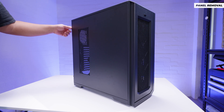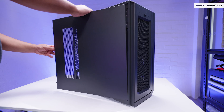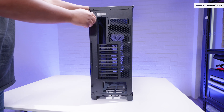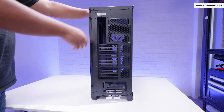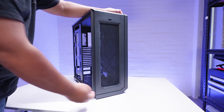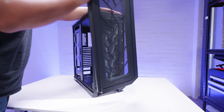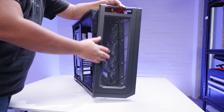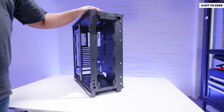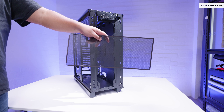Let's start off with panel removal. Each side panel has two captive thumb screws — just loosen those and pull the panel away from the case, jiggle it and lift it away. Same applies for the back side panel. The case is also very light because it's made from very thin material; it's meant to be a bit more industrial. The front panel can be removed as well — just grab the corner and give it a yank and work your way around. It's got a fabric mesh on the front, kind of like what we saw with the P600S from Phanteks. On the front there's a magnetic dust filter, and there's also one on the top of the case, plus both side panels have dust filters.